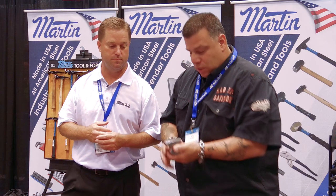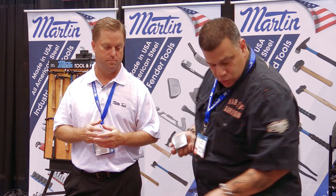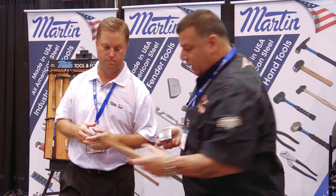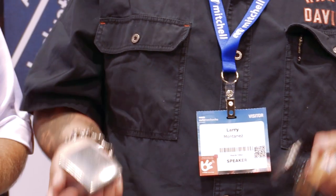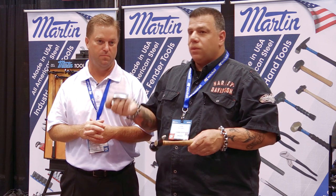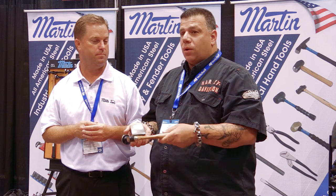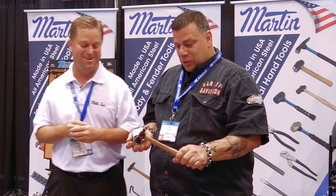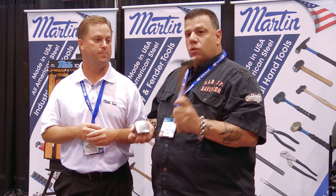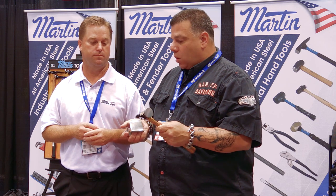With hammers, you often have the dollies behind there. What's the best technique for hammer and dolly work? We know there's hammer on dolly and hammer off dolly. We should always start with the off — push up on the area, work outside-in, and lightly tap. You can always tap harder, but you can't undo a hard tap. Go slow. Same thing with the pick side of the hammer — go lighter, it's easier and smarter.